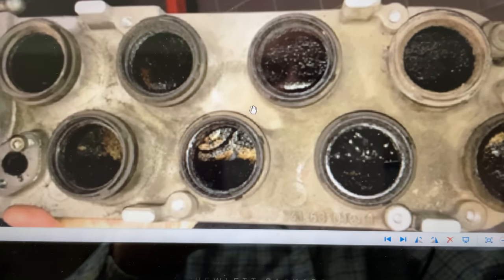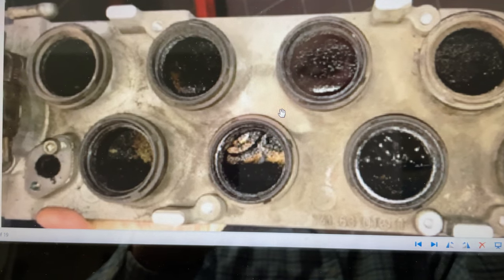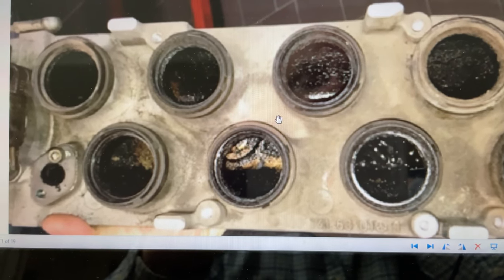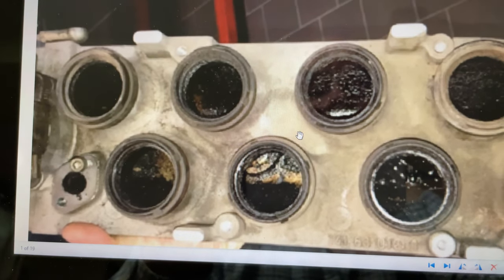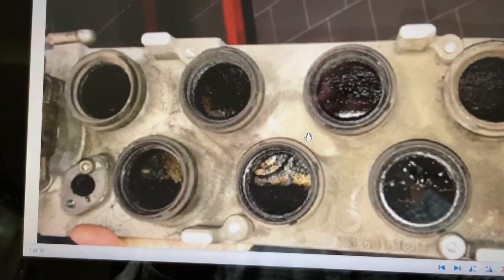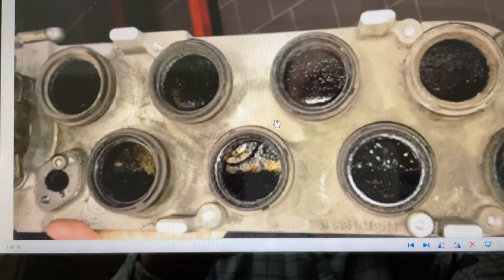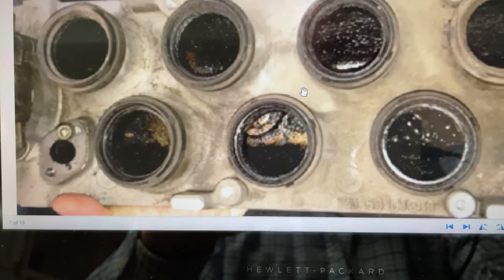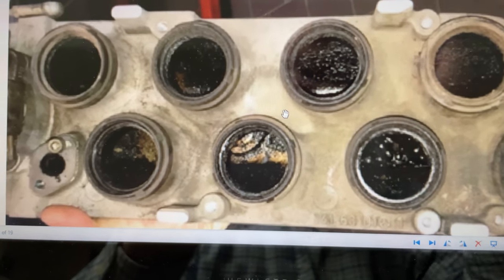This carbon buildup issue is typical for American-market cars only. The reason is the unleaded gas with catalytic converter and exhaust gas recirculation system. The German-market cars — which ran on leaded gas without a catalytic converter and made 272 or 290 horsepower (the special version for protective/armored service vehicles) — don't have this problem because exhaust gas doesn't recirculate back into the engine. Those are going to be a lot cleaner. This picture is from a 560SL which was originally in the US and shipped back to Germany to a repair shop.